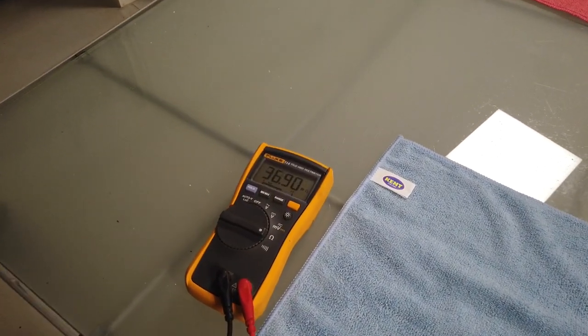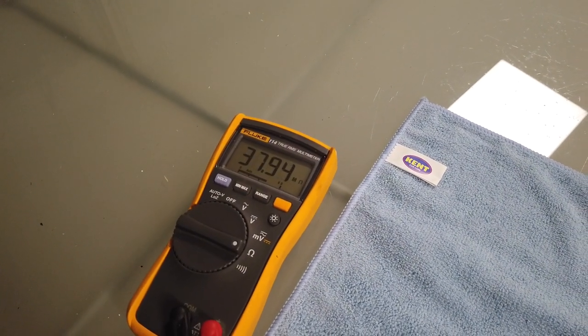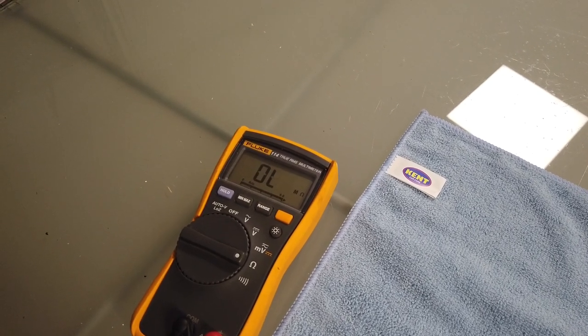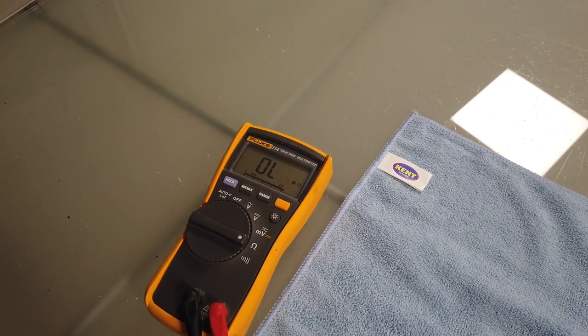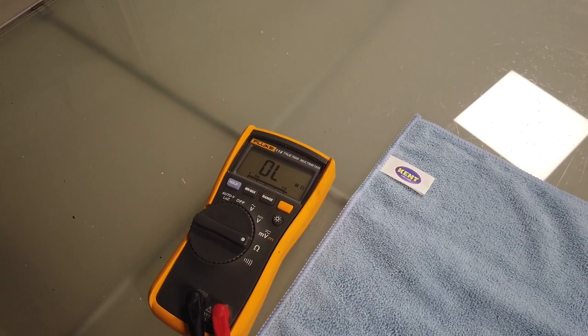Let's see what this one does. No banging. That is 36 mega ohms - that is not 2.7 ohms. I'm pretty sure that one has fired. Let's try and get it again - that is a really high resistance.